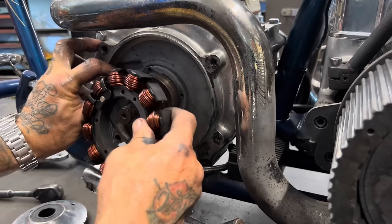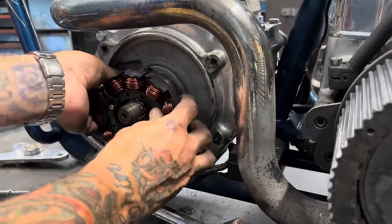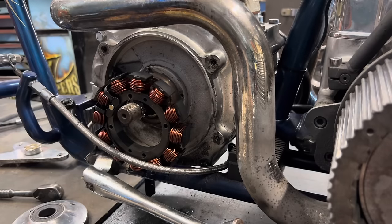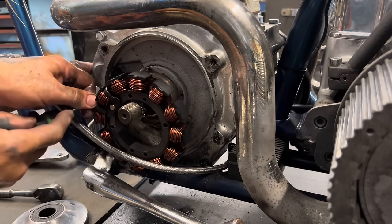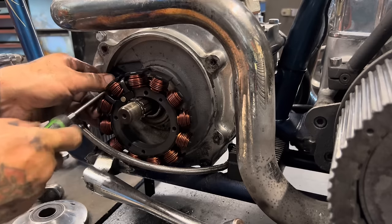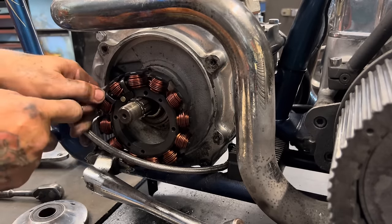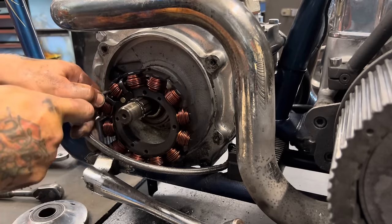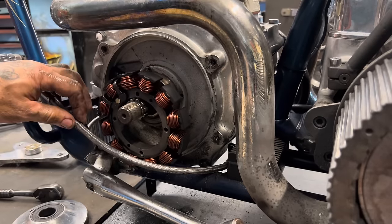I use some spray lube on the rubber plug that has to go through the case. It helps me get it through the case. These things aren't easy to get through there. As you're about to see, I'm gonna have to wrestle this thing through. It's a tight fit because it's supposed to seal oil from getting out and dirt from getting in. So it's supposed to seal really good. So I usually work it up through there with the screwdriver, being careful not to puncture the plug.